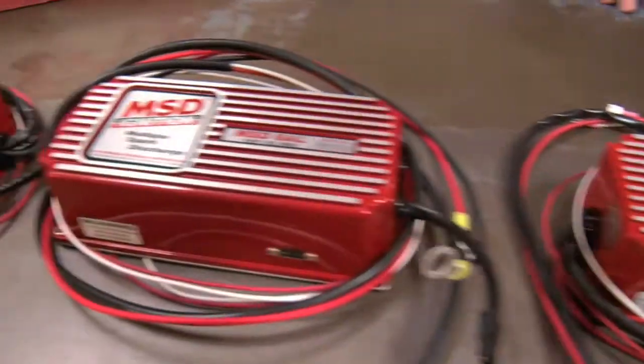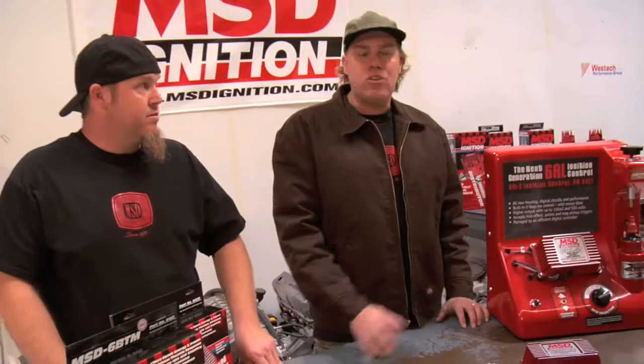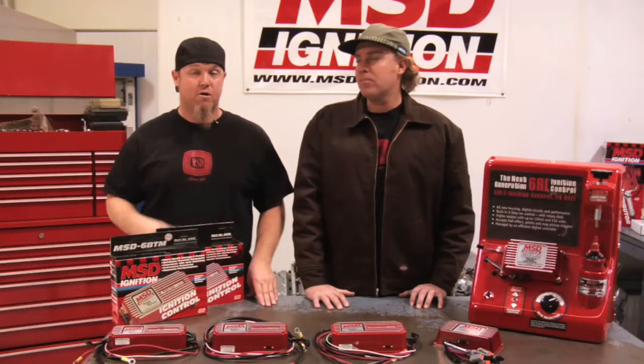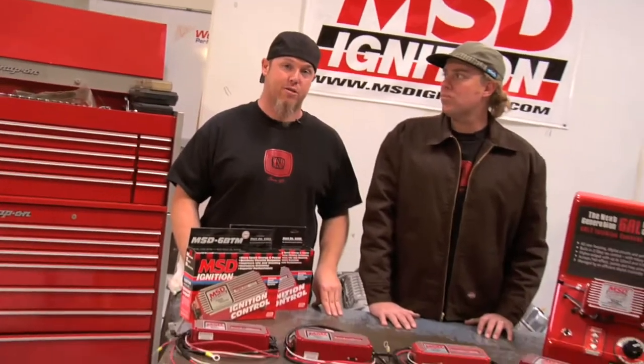Now MSD makes a ton of products to improve ignition, from the entry-level 5 series to the full race 7 series, but what we're going to talk about today is the basic 6 series CD MSD ignition systems that you find on muscle cars everywhere. All of MSD's 6 Series boxes are designed to be used with a distributor, whether a points or electronic style. For those of you with distributorless ignition, they also make boxes for those applications.